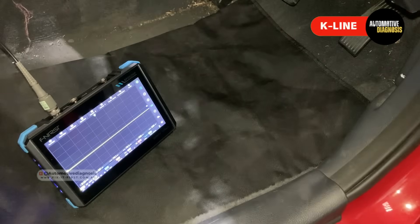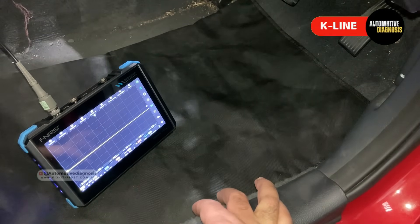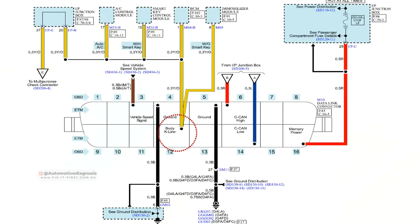Now let's go for the K-line. K-line is very similar to the LIN bus but it's used for different purposes. The main use of K-line is for scan tool communication with control units. Over time, K-line has been replaced by CAN bus, so on this car the K-line is used only for communication between the scan tool and some control units like the BCM and immobilizer. For other control units like the engine, transmission, ABS, and electric power steering, CAN bus is used. Like LIN bus, K-line uses only one wire for communication.